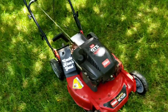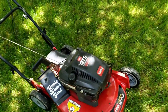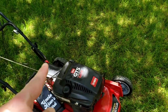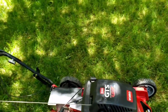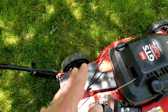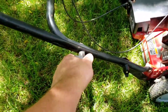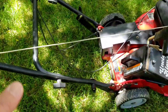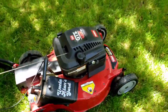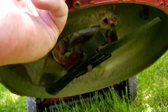Quick overview of what I did to get it into good running order: I replaced the air filter, spark plug, and I changed the oil because it was really black and dirty. I also replaced the drive belt — new belt on it, nice and smooth and tight. I replaced the handles and nuts and bolts because when I got them they were broken. I also put new front and back wheels on it and changed out the blade to an accelerator blade.